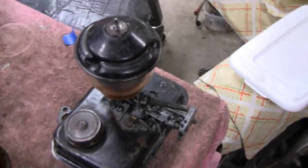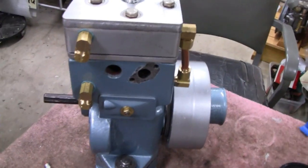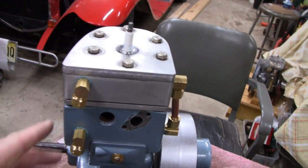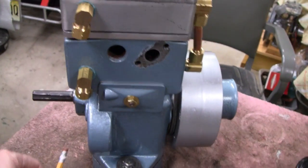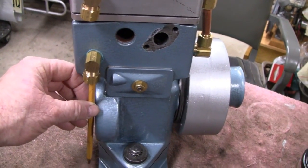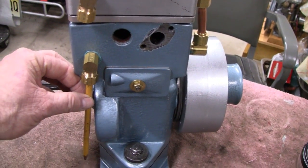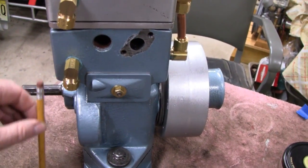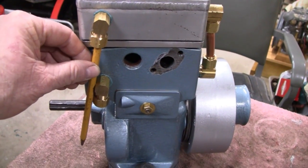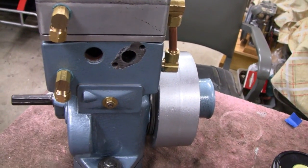Let me get this out and paint it. Got these fittings going into the head and block. I got them turned just a little askew there, because if you go straight down it's going to hit the engine and vibrate and wear through the paint. So if you put it askew, you'll have a little bit of room. And same with this one up here — this will come down alongside the other one, and then we can run dual pipes down. I think that'll look okay.